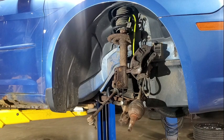Yeah, I was waiting on this slide that was supposed to be a misfire. And it ran fine when I first drove it in. So I got the right injector, so I swapped things around, and the misfire stayed. Then I did a compression test with the Pico scope, and that cylinder only got 67% while the rest of them are in the 90s. So I'm like, something's happening, tear it apart, figure it out. Which cylinder was that? Five. Oh, imagine that.